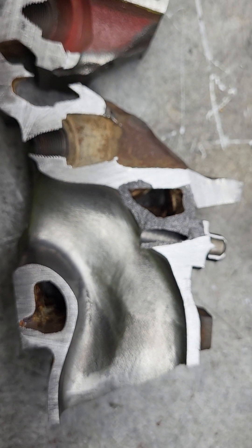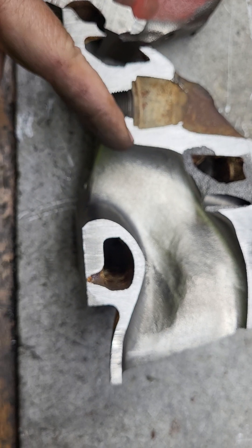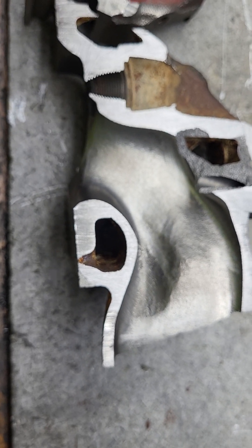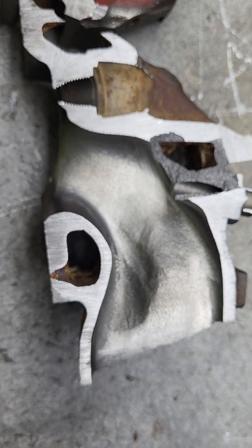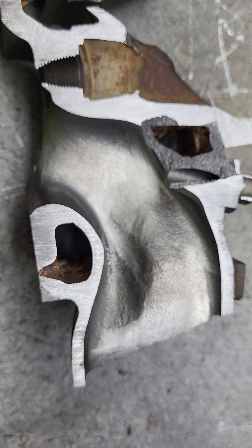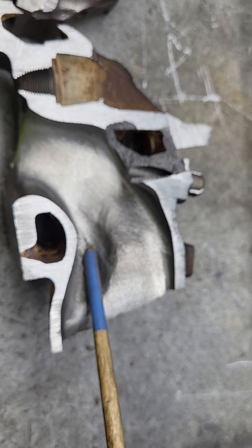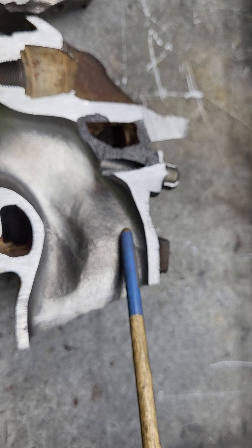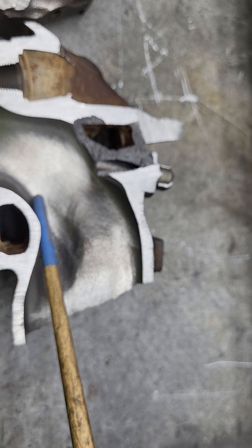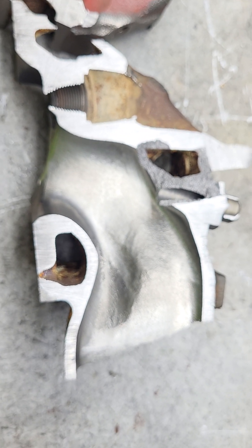From this angle, this bowl would come out a lot more this way. From the short side it's got a nice design — nice and high, good shape to it. In reality it's a little too big here, but you can see the change in area: very narrow on the roof, a lot of area on the short side. Because it's a truck head, they're looking for mid-range.